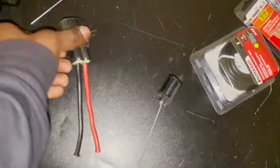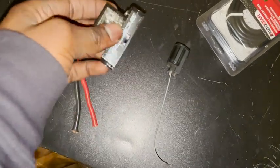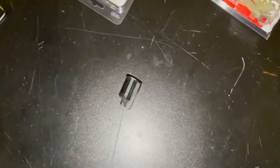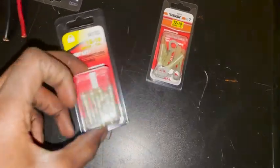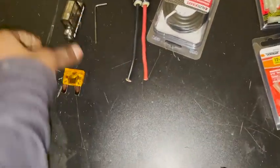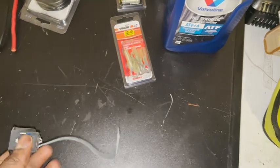The pump is sitting here and I'm going to make some mounts. As for wiring, it's actually pretty basic: constant power, fused with an 80-amp fuse — one of those subwoofer-style fuses — and then ground somewhere on the chassis nearby. I got 8-gauge wire, rated for this, about six feet each. I also got butt connectors, terminals, and some ATF to fill the pump. The kit came with an allen key and a 40-amp fuse which we won't need.